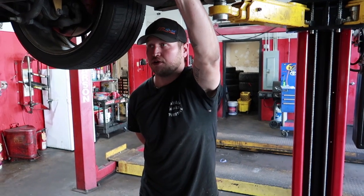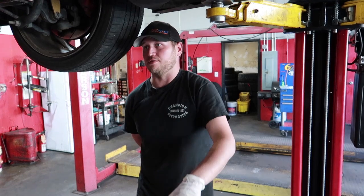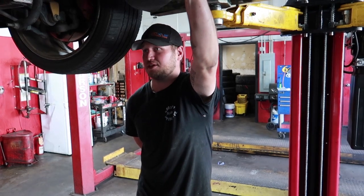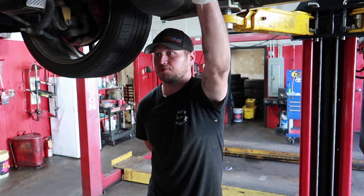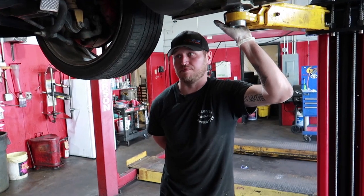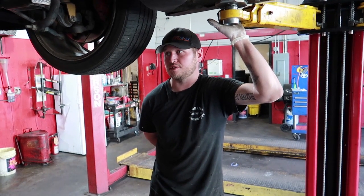That makes sense. I felt it on my truck. I've run a straight pipe on my truck, and at high RPMs, it just falls flat on its face, because I didn't have any back pressure. I ran true dual straight pipes, and it was louder than hell. I mean, it sounded good, but at high RPMs, it fell on its face. And I put mufflers on it, and it stopped. You could feel it. It pulled all the way to about 4,000 RPMs, then that was it.